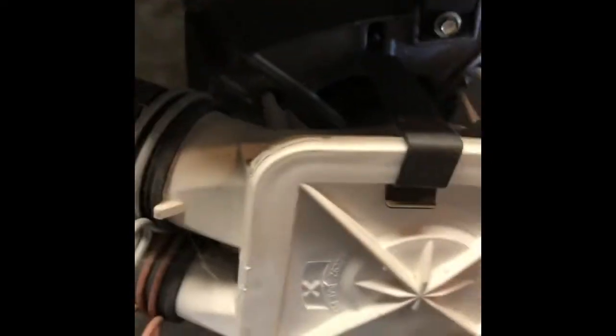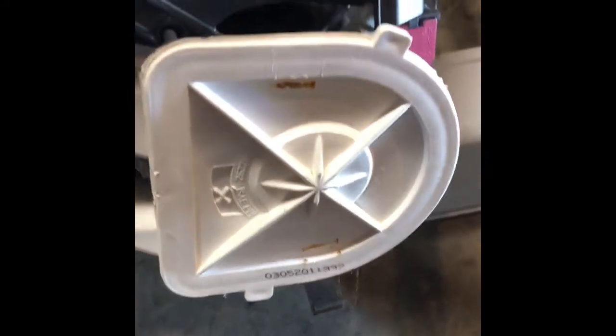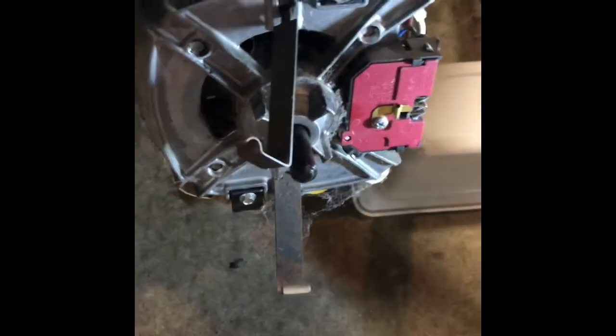And then I need to remove the water pump, and I'll just pull these little clips off. You can use a standard head screwdriver to help you do it. They just pop off. And you can grab the whole pump and pull it towards you. It'll come off the motor shaft. And then I usually just push the pump out of the way so it's not in the way as I remove the motor.